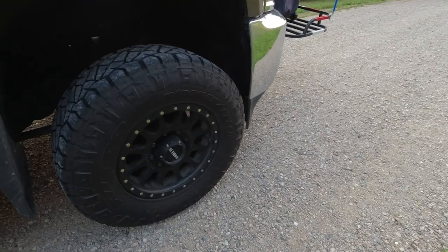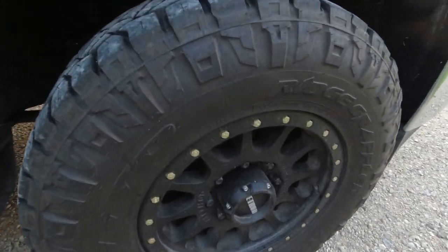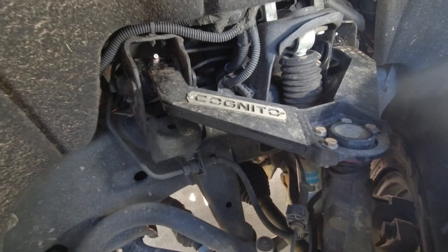Well, I needed to lift up the front end of my truck to make those tires fit. I went with a leveling kit — specifically the SuspensionMax kit. The nice thing about that kit is it comes with differential drop spacers, which lowered my front differential down and keeps the geometry a lot closer to level. I also changed out the control arms, because when you're off-road you need as much articulation as you can get. If you crank up the torsion bars on a stock truck and leave the original factory control arms in, you're going to lose all articulation.